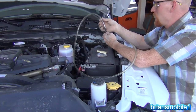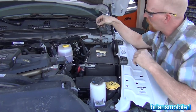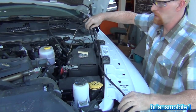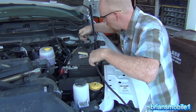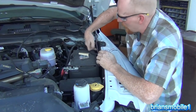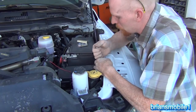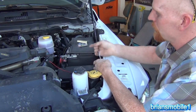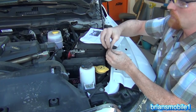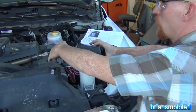You'll see the little o-ring in here. Just pull it off — if you pull too hard, obviously it's going to come undone on you. This little black eyelet is going to go right here to the ground and the body. It's just these two wires that you need to run back behind the battery through here. My advice is to take this wire, run it back behind this bracket, feed it through, get everything pulled out, and then go through again just like you're sewing something. Loosen your ground right by the power distribution center — PDC as it's called in the instructions — and just tag it in there. I'm tagged in with my ground; I have a really short leash on the positive, and that's all you need — it's just right here.